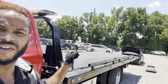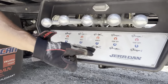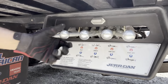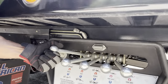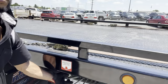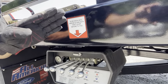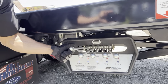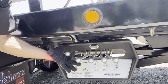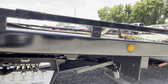Now let's go ahead and lower the bed and make sure that we get it close enough to the car. In this case, I already moved the car behind the tow truck. Right here on these truck beds, you're going to have every single position that these different handles do. This one — you lift it, it pushes the bed back. Right here is the tilt point. You want to make sure that once it reaches right here, you're able to tilt the bed down so you don't cause any damage. This one is the next one we're going to use, which lowers the bed. I normally hit them both at the same time.